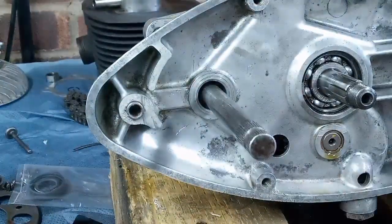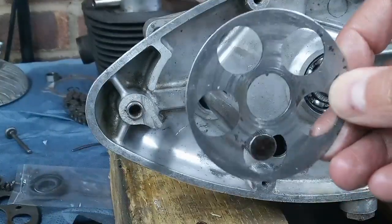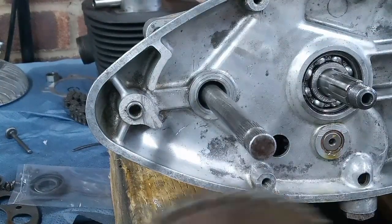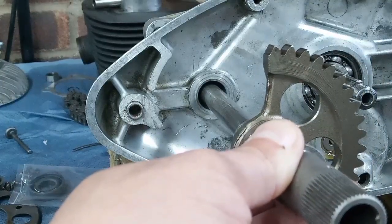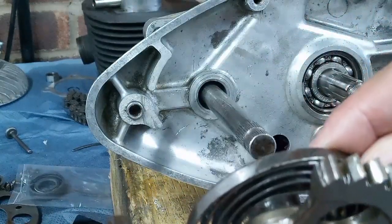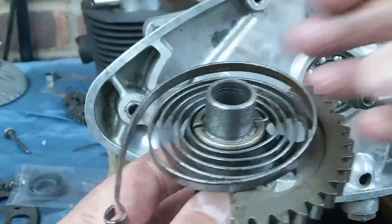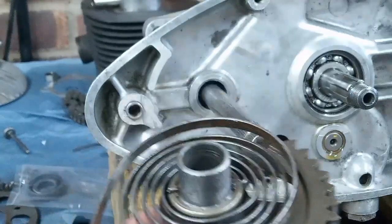But before that can go on, you've got this little disc that prevents the whole thing from wearing its way through the casing. So we need that piece on. So this is how I do it. It goes on like that. That's the way it's going to go. The spring's got to be like that, so that can only really engage in one of the little dogs on the back. So you can see that is there. So let me just let you digest that bit of information.